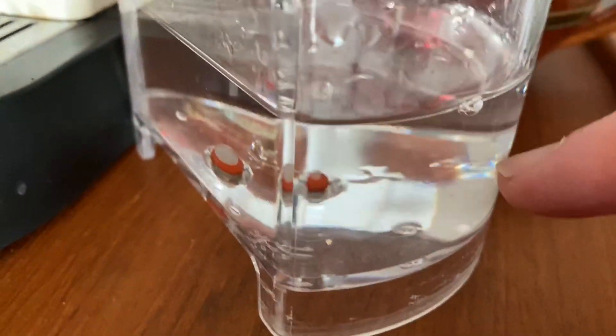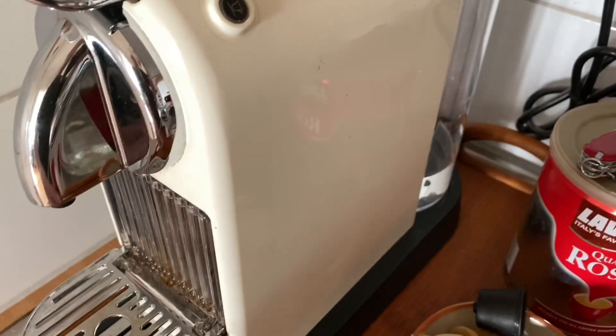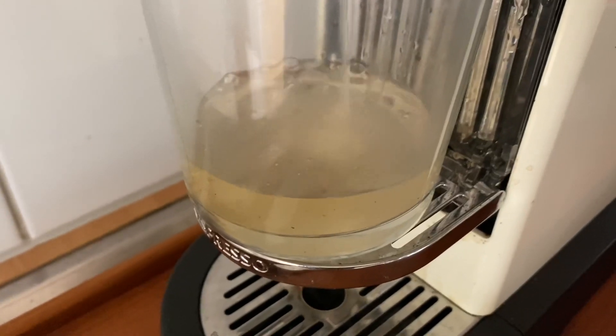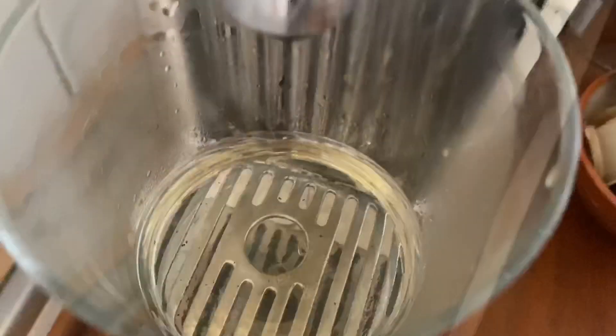So we have approximately 12% acetic acid here — twice as concentrated as white vinegar. This concentration is no problem to put your fingers in, but it smells really bad. We mount this back on the machine, turn it on, and I don't expect to get much off on the first run. But when we let it sit for a while, it's going to dissolve the inorganic material inside the tubes that's making our coffee dirty. Now I'll just use a little to fill the pipes and let them sit.